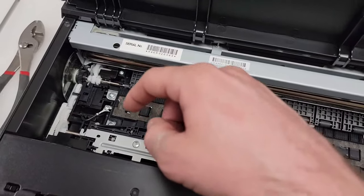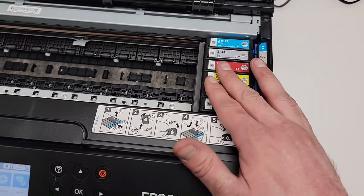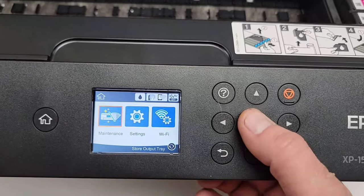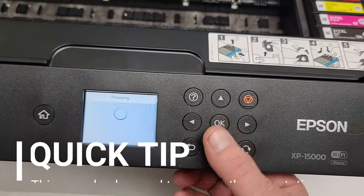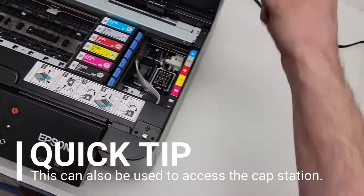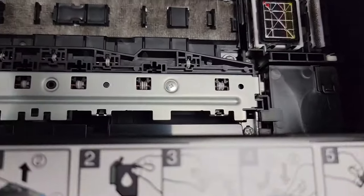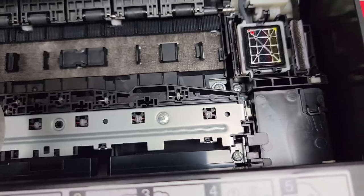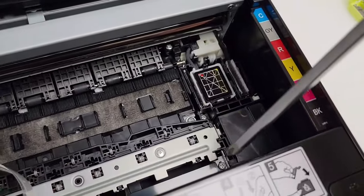On this side of the bar you'll see a similar little paper-clip piece of metal, and then you'll see the screw and the metal bracket. The easiest way to get access to that is to go in and perform a head cleaning, and we're going to pull the power right as the printhead undocks itself. Power's off — we can move this all the way over to the side. You'll see we have another screw and then the little paper-clip-looking piece of metal holding it into place, so let's go ahead and get that out of there.